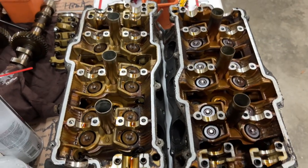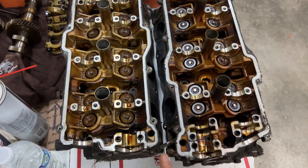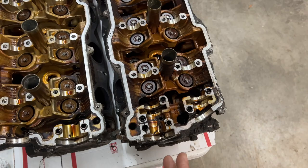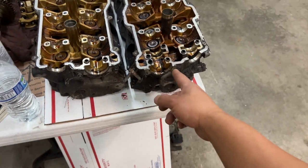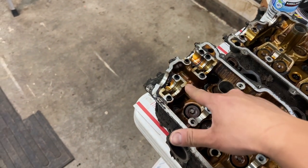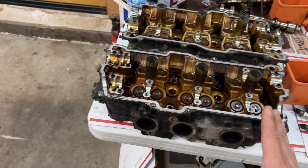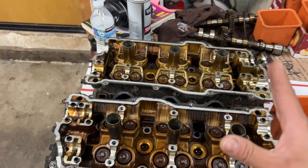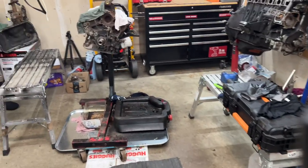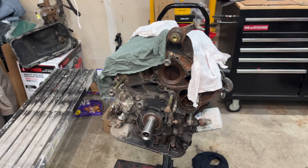When you have both heads front-facing, you can look at the back - one is flush and one is more curved. But it's easy to get them mixed up if one gets spun around. Just make sure you know which is which because it can get confusing after a long day or long month of overhauling an engine.